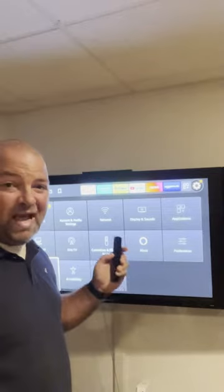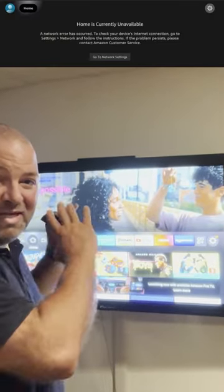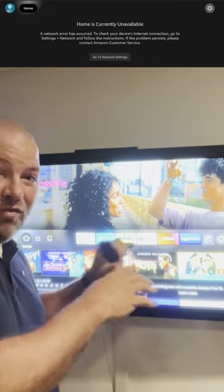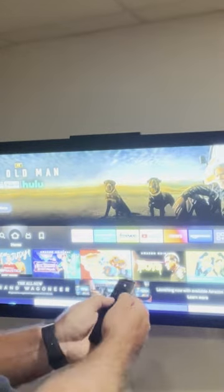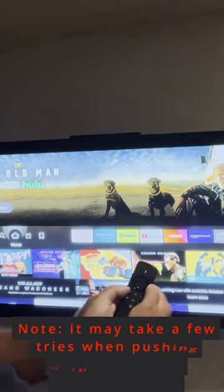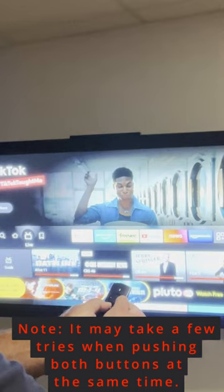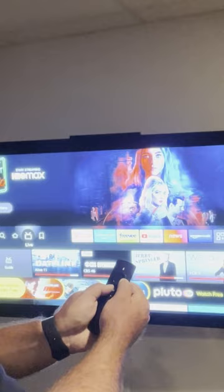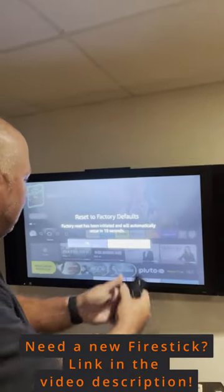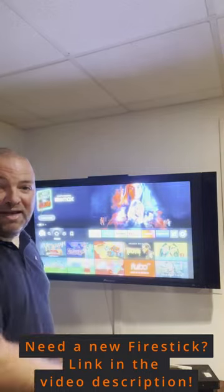The other option I had to use was the reset to factory default from the remote, because I was getting a 'home screen unavailable' message over and over after trying a bunch of other troubleshooting steps. All you have to do is hold the right arrow key and the back button at the same time for about 10 to 15 seconds, and you'll get prompted with a pop-up message that says 'reset to factory defaults.' I don't want to reset mine, but you get the idea.